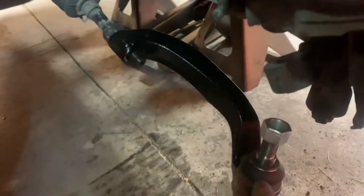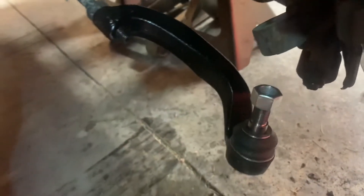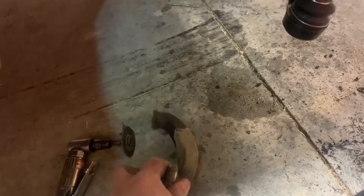I got my old one off and I've put my new one on. I've measured my length from the dead center of this back to this, so I should be pretty close. This one was giving me trouble coming off, so what I did is I simply took my 90-degree cutoff wheel and cut down the top and bottom of it right down to where it met the threads, then used a chisel to just pop it off. Saved me a lot of time and fight. I don't have a torch here in the shop, so I could have just heated it up with a torch and it probably would have come loose, but doing this saved me some time.